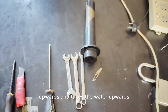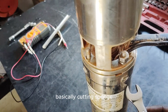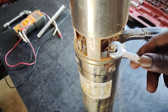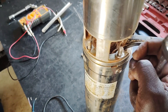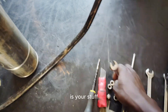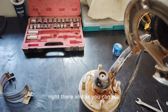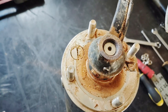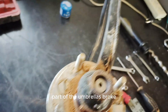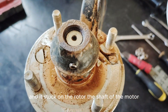Let's go ahead and disconnect the upper bit — the impellers — from the motor itself. It depends on the kind of pump you have. Put your stuff in a secure place. That's the disconnection right there — all you have to do is pull this off. As you can see, part of the impeller broke off and is stuck on the rotor shaft of the motor.